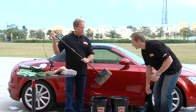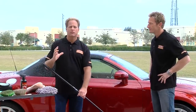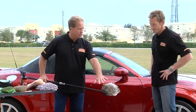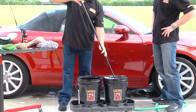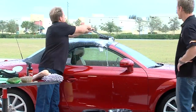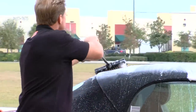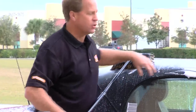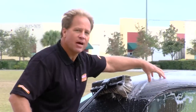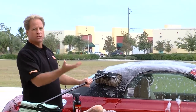Convertible tops come from the factory with a waterproof coating, so the last thing you want to do is use any kind of abrasive or coarse brush because you're going to scrub that coating off. We've got a boar's hair brush, and these are perfectly designed to fit inside the five gallon bucket. I'm going to dip this in, gather up some of the Wolfgang Auto Bath car wash solution, and then just run this over the top. This is going to be real gentle to this fabric top, and it will get into the weave. When a top is parked outside, dust settles into that weave, so you want to wash the dirt out of that weave before applying any protective coating — otherwise you'll trap that dirt in.